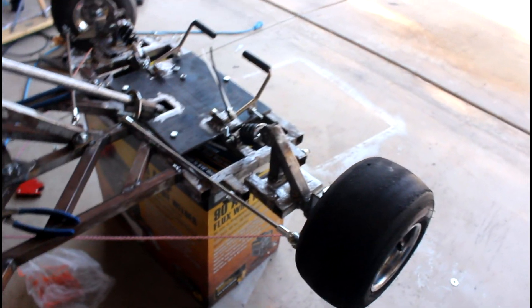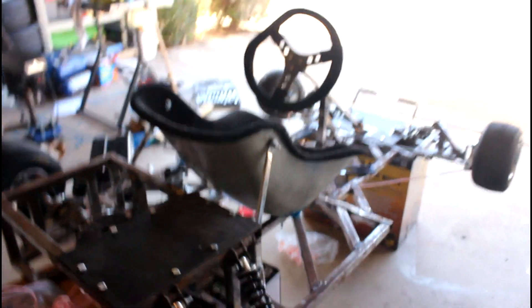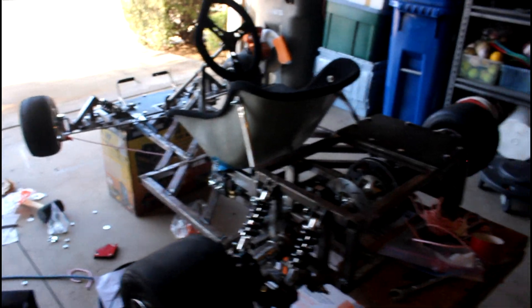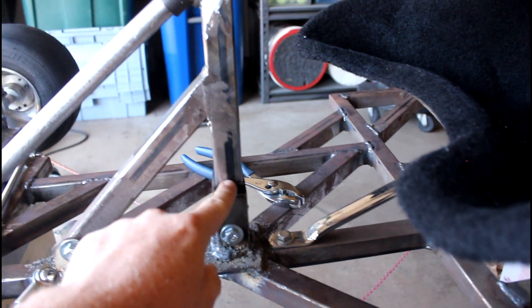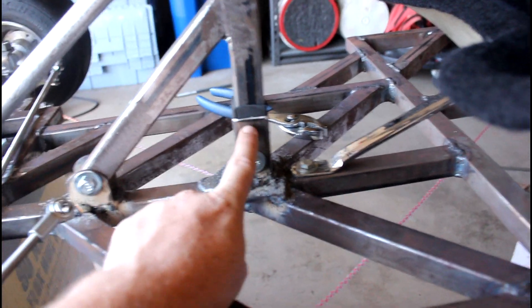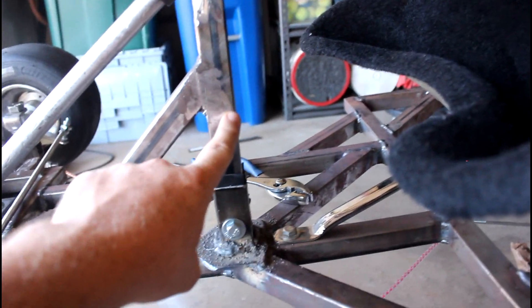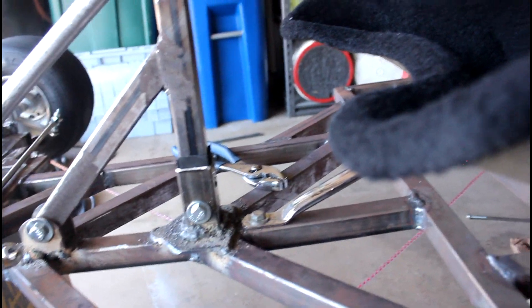I at least wanted to update you guys so you're caught up with what's been going on with the go-kart. It looks pretty cool — I really like how it's looking. One thing I have to fix is that the removable steering column is a little shaky because the tubing doesn't precisely fit inside the larger tubing. I tried foam to fill the gap but it's not working, so I'm going to weld onto it and grind it down until it fits just tight and snug into the lower tubing so I don't get any shake or vibration from the steering column.